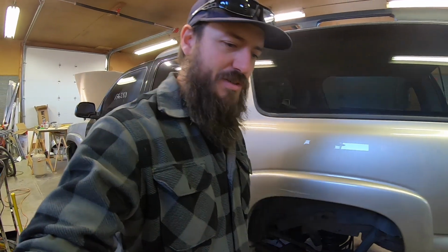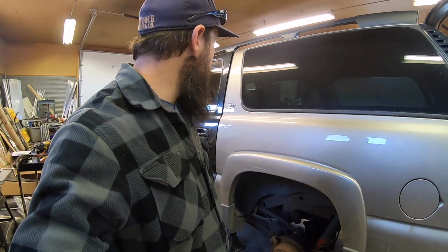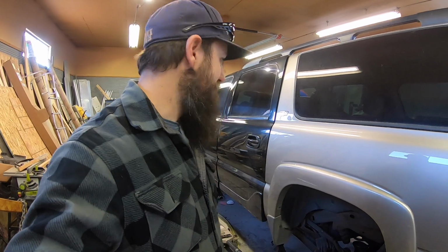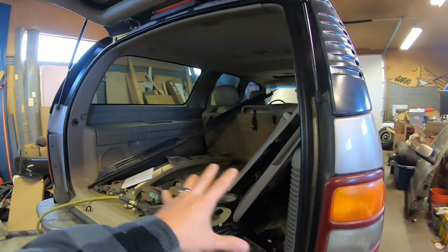We got some alignment work to do on that, no big deal. We got a torch, we'll kind of heat stuff up and gently tap it around until everything lines up, and then we're gonna put a new set of door pins in there to help keep everything lined up too. So anyway, coming back together with that. Once that's all dialed in, take the doors back off, sanding and painting time. We gotta get that done. Then we can get all our stuff put back on the doors.